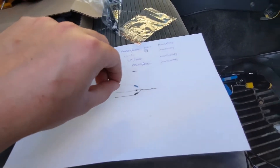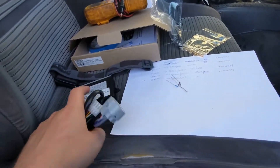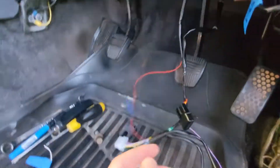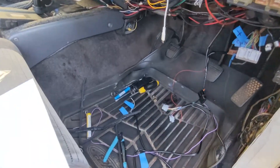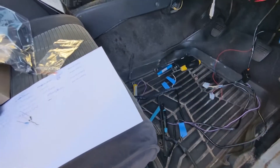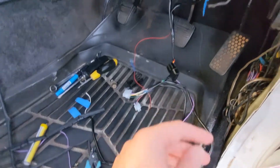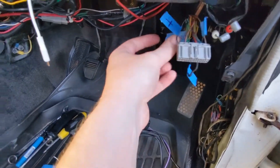I then have to use the little jumper harness for the pedal that'll plug into the ECU here, and another harness from the kit also connects to the ECU. I've connected it into the brake pedal switch — there's a little jumper harness so I get the brake signal. For the clutch, I've got a little clutch switch that I'm going to wind in where the factory stopper used to go — that'll give me my clutch signal so when you push the clutch in it'll deactivate the cruise control, which is required by law.